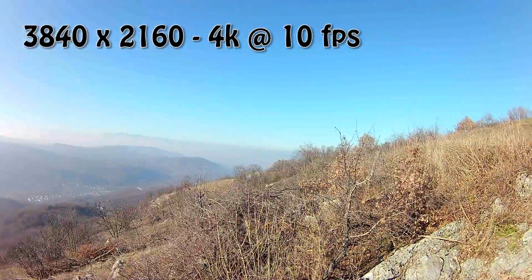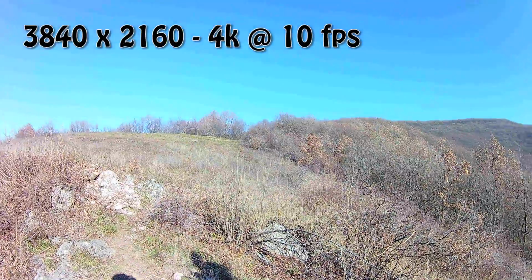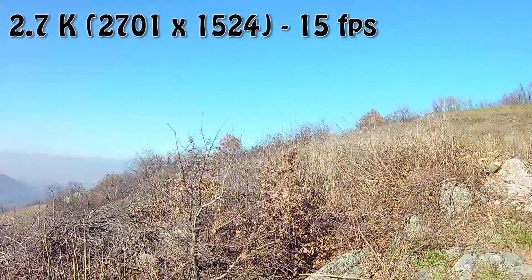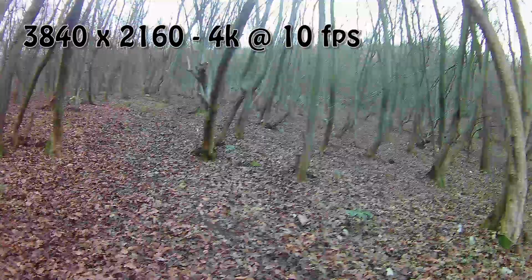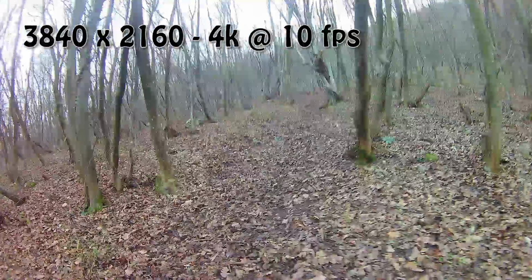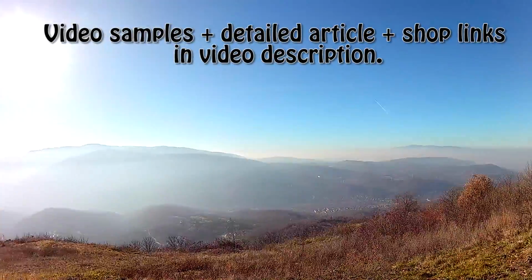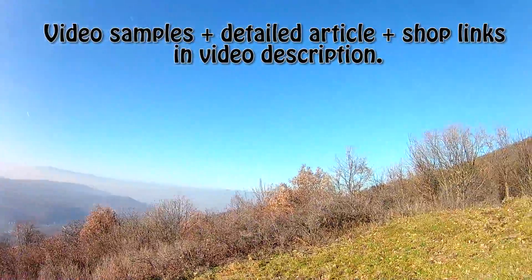So if you want to buy a 4K camera, you need to buy something real like GoPro Hero 4 Black or Sony cameras. Also, it has 2.7K resolution, which also has only 15 frames per second. Do not think that you will be able to record anything useful with 4K and 2.7K. This is just a marketing trick by these guys, and I really cannot imagine anyone shooting at 15 frames per second, especially with an action camera. Ridiculous. On the bright side, the camera can record at 60 frames per second in full HD mode and also in 30 frames per second. I also should mention that I uploaded some raw video samples so you can download them. I'll put a link in the description of this video as well as in my article.